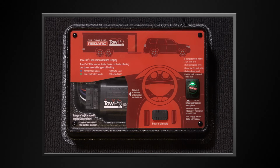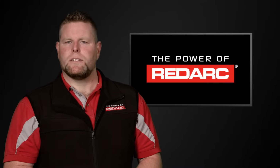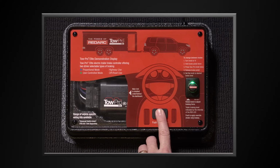If the mode change is successful, the LED will change colour. In user control mode or manual mode, the level of power delivered to the trailer brakes is set by the control knob. When the brake is applied, the trailer and vehicle brake lights will illuminate. The trailer brakes come on to the level that has been set on the remote head, and it does not consider how hard the vehicle is braking.